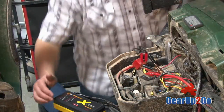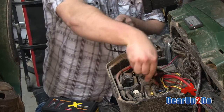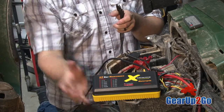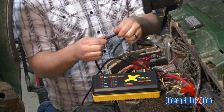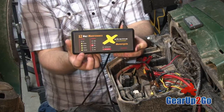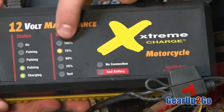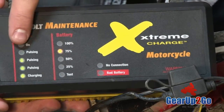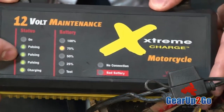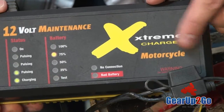Let's take a look at actually hooking this thing up. You have your charger, and we'll hook up the positive and negative leads first. The charger is in the on position, and once we plug the connectors in, it will test the battery and tell us what state the battery is in, and then whether it's charging or pulsating. You can see that it's telling me this battery is at 75% — it's charging. If it's not charging, the charge light will go off and it'll just be pulsating, which is float mode, which is breaking up the sulfur out of the plates. You can extend your battery life by a few times just by using this charger.